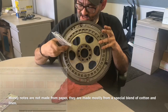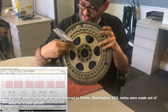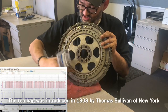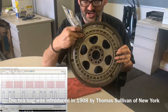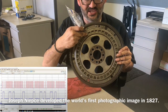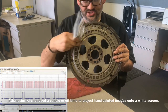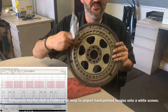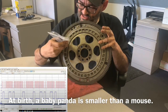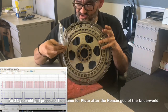And as it reads that process, it's going to communicate along with the sensor that picks up the signal from the cam sensor, telling it where the engine is at. It's going to communicate that information to your ECM, and then your engine always knows where it's at and that it's in time correctly. When this signal variates between the two, it shuts itself off and tells the engine not to start because it knows it's out of time.